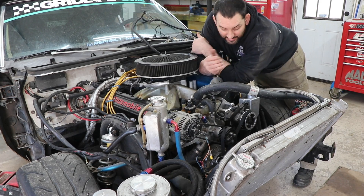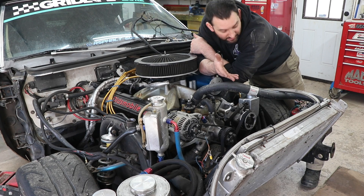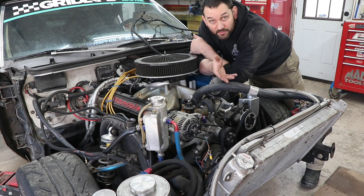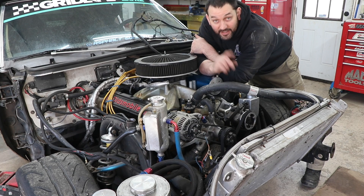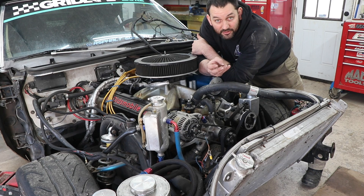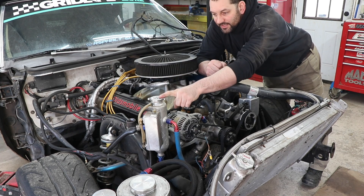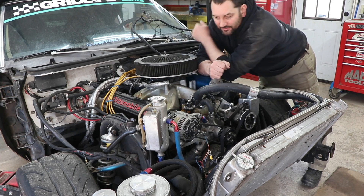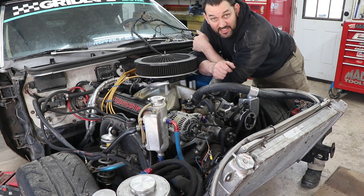Because I'm racing this car, I have done all of the cooling things. I have a slightly smaller but aluminum radiator — it's aluminum instead of copper, so it cools better. I have a high-volume water pump; you want to find one that has a good impeller on it rather than just going off what claims to be a high-volume pump, because the difference in impeller designs can make a huge difference. But the key one that really solved all of my issues — and disappointingly it was the last mod I did — was adding an expansion tank to the system.